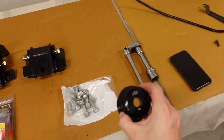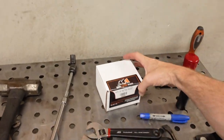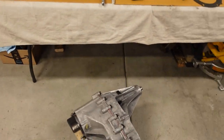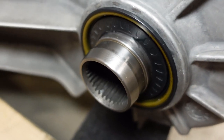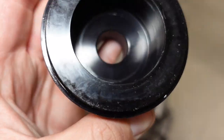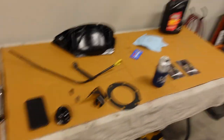The only other thing I wanted to mention is this cool seal driver from Merchant Automotive, part number 10325. They sell this for Duramax trucks — the NP261 and 263 — but those transfer cases actually share the same output seal as a 246 and the NV149. The inner part of the seal is a press fit onto the output shaft and spins with it, while the outer part is stuck into the case. This driver has a step machined onto it that bottoms out on the inside, so you just line it up, tap it in, and it goes to the perfect depth every single time. They're like $40 — an awesome deal. Not sponsored, just something worth sharing.